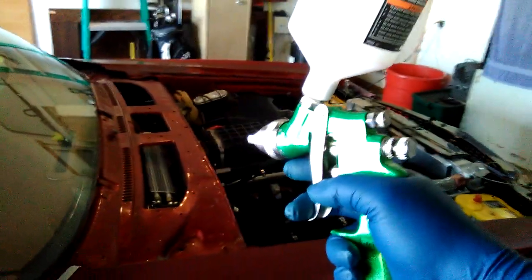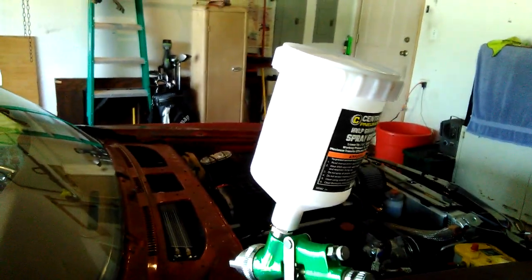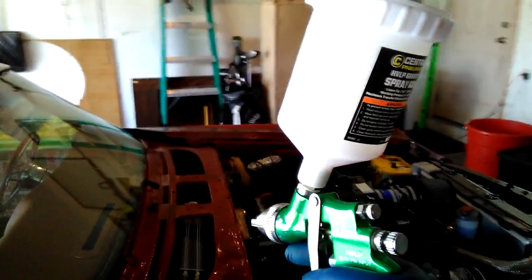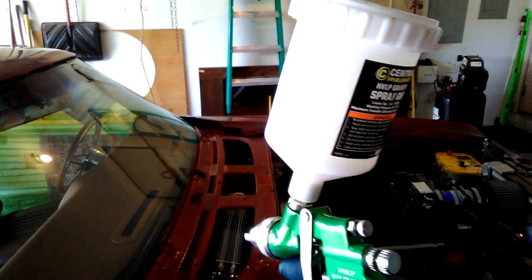But it's gonna degrease and clean the surface real nice. And so the little trick is you go ahead and you fill up the paint gun with, like I said, about 70-80% rubbing alcohol. I buy it by the gallon. It comes 100% or 99%, but you do want to water it down a little bit. 100% is pretty strong. But you go ahead and get it about 70-75%,